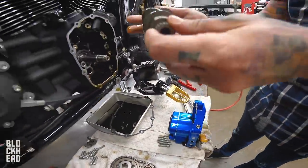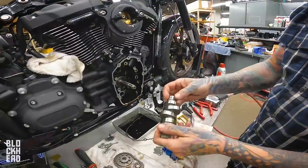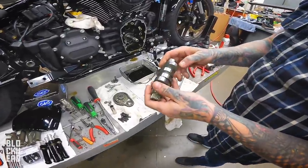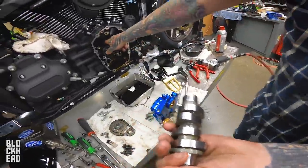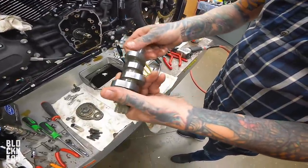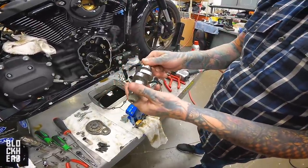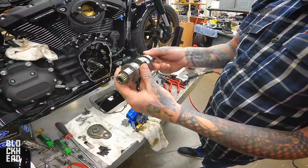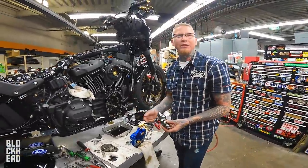Wow. Look how pretty blue that is. Here's your 517 cam. Screaming Eagle Harley-Davidson. So it doesn't have too many miles on it. Doesn't look too bad. So what we're eyeballing here is the wear surfaces. This is where the bearing rides on the cam. This inner bearing rides on the cam in there. This is where the lifter wheels roll on the cam, and as the cam reaches its peak and it rolls this, sometimes it'll literally jump, it'll fall off depending on how big the cam is, or how the lobes are. And I'm just looking for even normal wear, anything abnormal or anything pitting, scratches, gouges, or whatever. Yeah, anything bad, obviously that's going to give us a good indication that we need to go further.